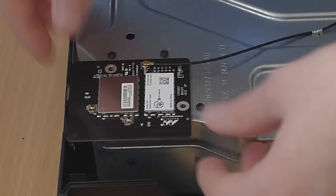Now we've got to take off the screws on the console. The next step is to remove the screws holding the actual case in place. There are eight screws in total and they are all marked - there's a little 'C' next to each one, so C1 through C8. Right next to each screw you'll see a little marking in the casing itself. C7, C6 - you can't read them clearly on camera but they are there and noticeable, so you'll know which ones to take out.